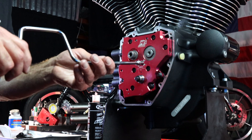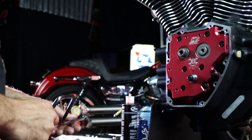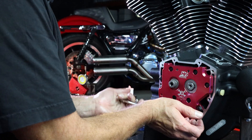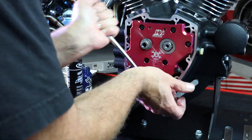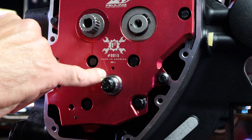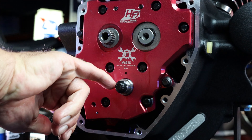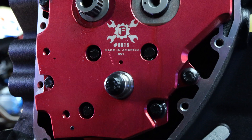This process is going to center the cam plate and oil pump as best as possible to the crankshaft. We all know that all crankshafts have some runout in them. The cam plate has a machine line in it so you can line up for TDC. We've got the flat of the crankshaft lined up right here — we're ready to rock and roll.